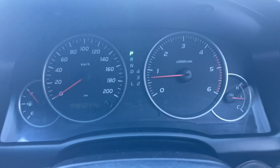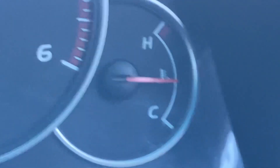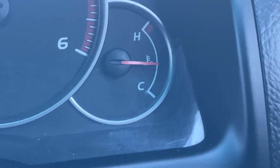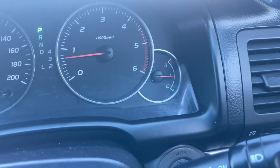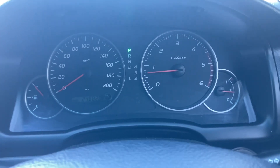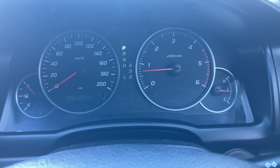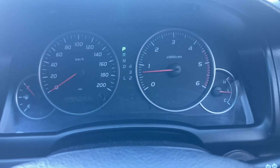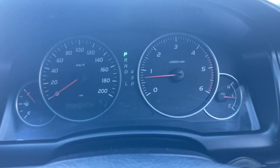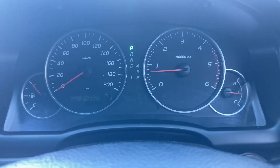These engines, if you're driving them even in cold weather, five minutes and you should see it on normal on the temperature gauge - just below half. Yours could sit a little bit higher and it's all normal. The only way to know what the coolant temperature actually is, is to have something that plugs into the OBD port and reads that temperature. I'd recommend against drilling a hole for a coolant temperature sensor - you're going to have leaks. So get yourself some sort of scan tool - sit tight, we'll have a discount code soon.